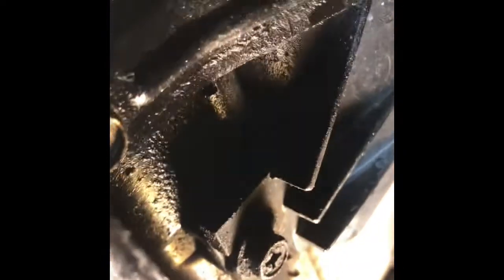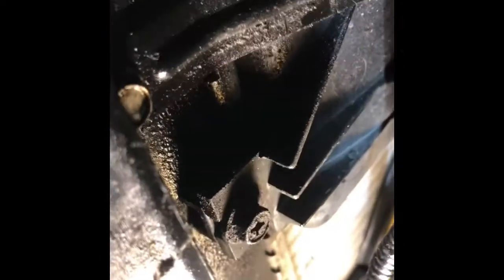Let me show you after I put everything together — it's so simple and easy. There's a hose clamp right there. Just press the clamp and it will come off from here and from the radiator right there as well. There's a hose clamp right there. When you loosen it up, there will be fluid that comes out easily. Make sure when you do that, put something underneath like a catch pan or something.